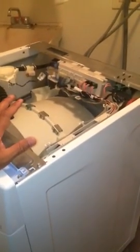I did all the diligence on YouTube, guys. I did all my blogging. I read everybody's inserts and what their issue is. I listened to Houston, and Houston hit all the good marks, because whenever you get an FH error, it talks about more of the water situation. So first and foremost, you've got to check your water pressure, which I did. Everything was solid. It was flowing, so there was no clog.